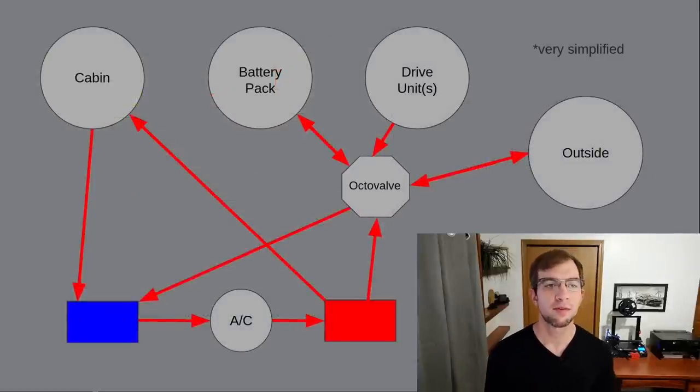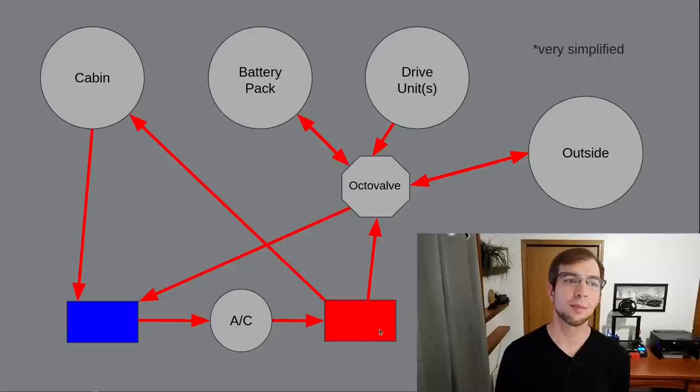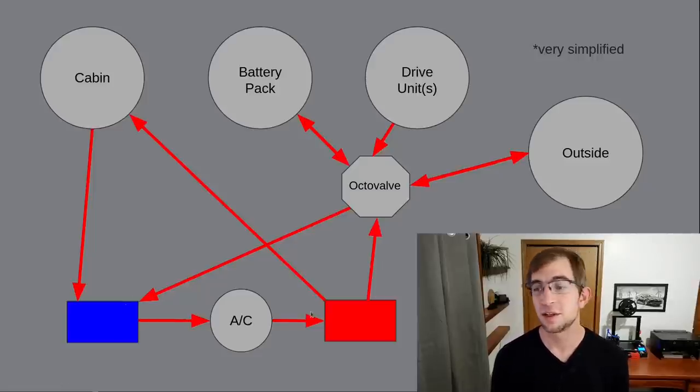At the center of the system we have an air conditioner that pumps heat from the cold side to the hot side. We'll learn more about how air conditioning and heat pumps work in the next video of the series. For now, the only understanding you need is that heat gets pulled from here — it gets cold — the heat gets pushed to here — it gets hot. One interesting fact to note is that unlike virtually all other heat pump systems, there is no reversing valve and the refrigerant always flows the same direction. The hot side is always the hot side and the cold side is always the cold side. They do not switch functions as in a typical heat pump system. Instead, we just utilize whichever side of the air conditioner is needed.